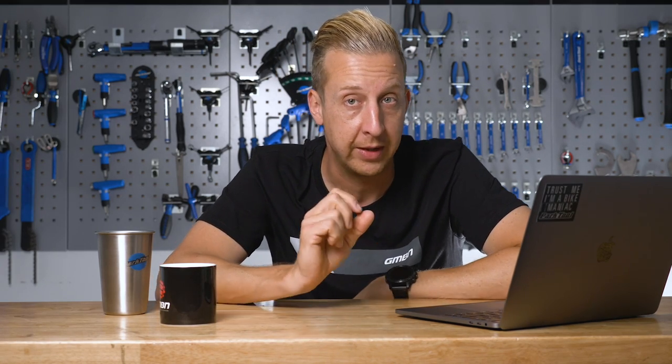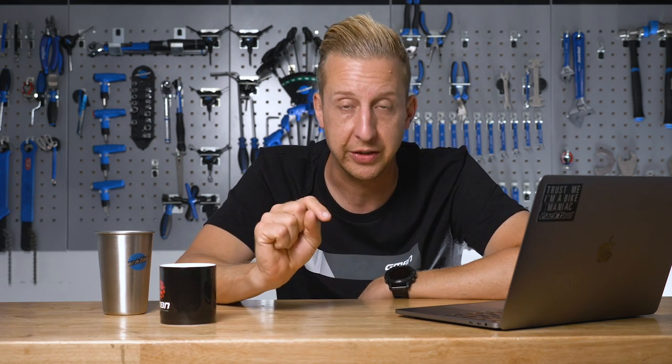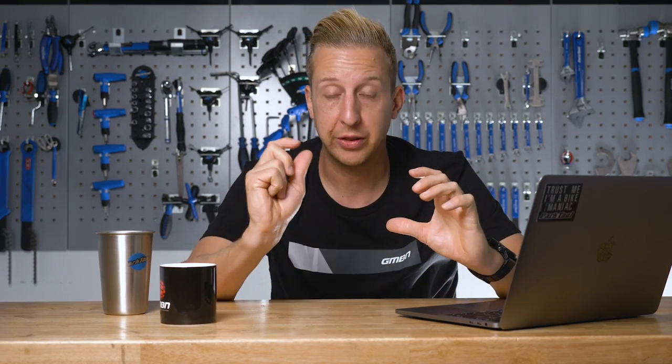There's a lot of clearance in there, so the wheel will fit in the back. With a 27.5-inch fork, clearance is no problem. The first thing it will do is bump up your bottom bracket — quite a lot more than you think. You'll really notice that, especially without a dropper post. At traffic lights when you want to put your foot down, you'll have to get off the saddle because you won't reach the floor on your toes. I noticed this on my commuter running 26 by 2.4, and now running a 650b with 42mm tires — they're only slightly bigger but I can already notice it.